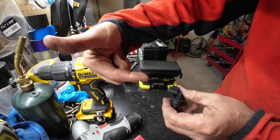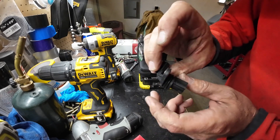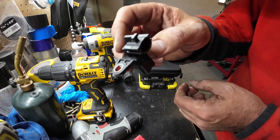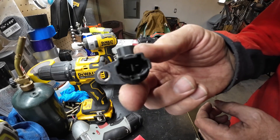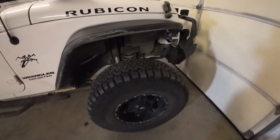What's confusing is it says 'Crown Automotive Axle Locker Sensor Connector,' but this has really nothing to do with the sensor. The sensor with a plunger that screws into the side of the differential is a totally different connector and does not use this. This is actually the locker actuator connector — that would be a better word. This is what carries the current that energizes the electronic locker, so it's not really a sensor connector. But it does have this end just like it's supposed to, with one little screw hole. So if you're going to buy this part, don't let that confuse you.